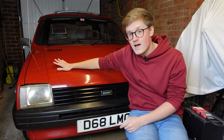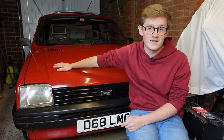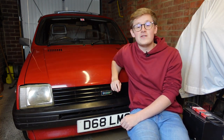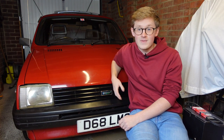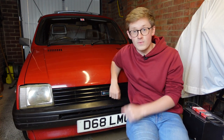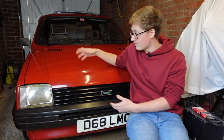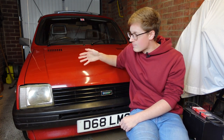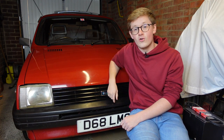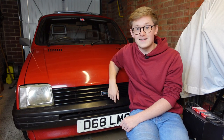So I put a new battery in her, but I then went and tested the voltage when the car was running once I put the new battery in, and it was only 12.7 volts. That says to me that the alternator is slightly knackered, so that's what we're going to do today — see if we can get her working, at least reliably enough, without possibly breaking another battery, so that I can go and record the reveal video that you lot have already seen.